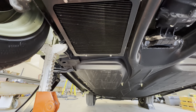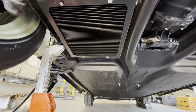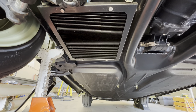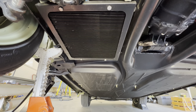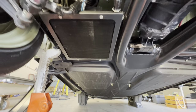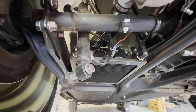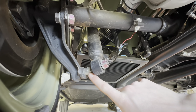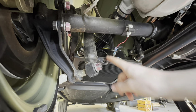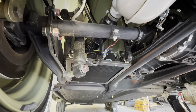I haven't really found anything get stuck up in there or anything, and it's done a really good job. I've gotten a tiny bit close to overheating, but that was when I was driving when it was like 40 degrees out here, which was very hot for Canada. But it works really well. The one issue I can still see right now: I put a couple spacers in and a longer bolt on this shock, because that was where I was having a clearance issue — this shock was where that oil cooler is supposed to be.